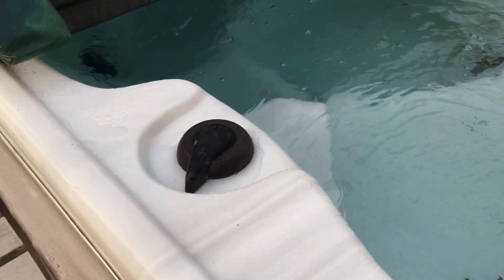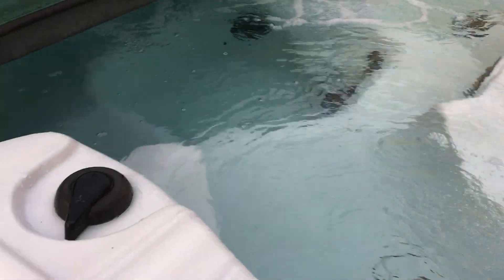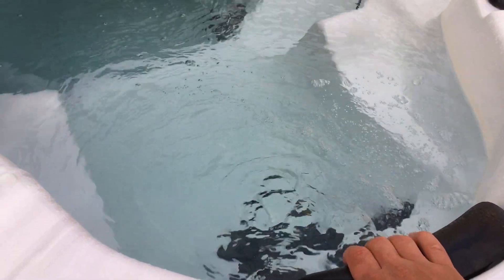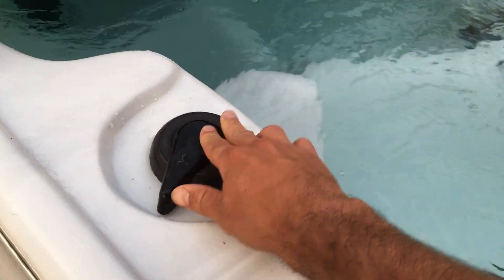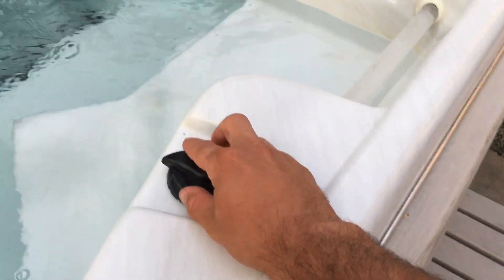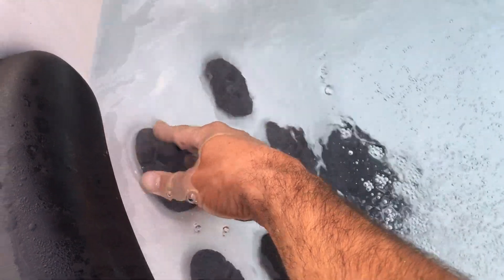You're going to see these black dials along the side of the hot tub. This is your main dial to operate — this spa only has one pump. You turn it either way while the pump is not running, and that centralizes the filter to one area or all four areas of the hot tub by turning it slightly. These two controls are for aeration — that makes a big difference. Turning the dial circulates air through the jets or not. I have them both open because we want to create lots of bubbles. To close a jet, you turn it to the right; to open it, you turn to the left. You can feel that the jets are pushing in all directions.